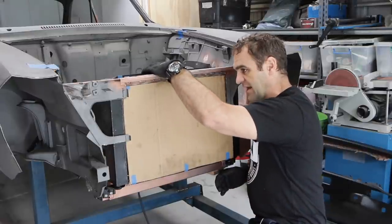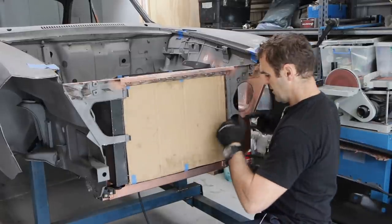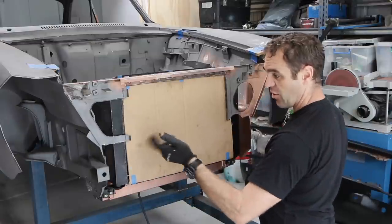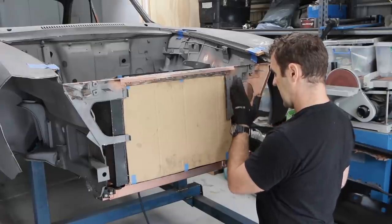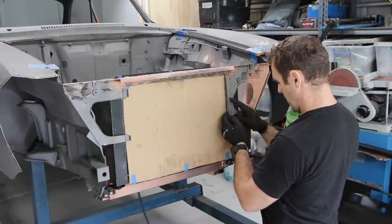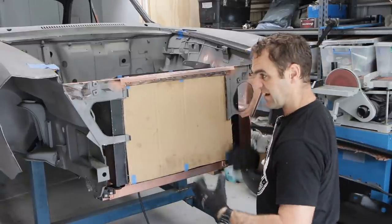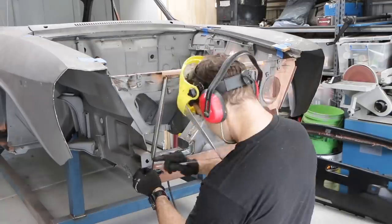Now the radiator is here and it's mounted, I'm working out what to do with the bottom half of this. As I mentioned earlier, below these pieces there was a panel that went backwards and met up with this back rail on both sides. I've cut it off because it's not going to fit, and I'm just trying to work out how to restructure these areas and make them work. I'm thinking I might actually build a triangular bent piece that goes from up here down to these lower corners on both sides - just to give it a little bit of extra structure. Let's get to folding up and building those bits.